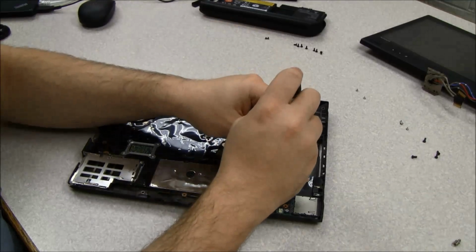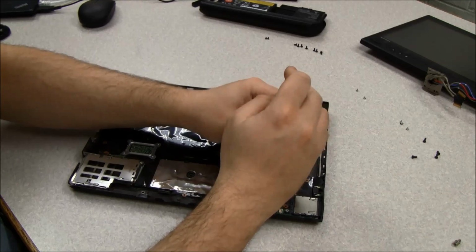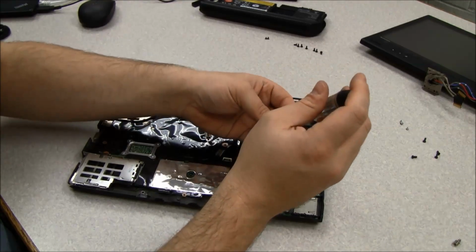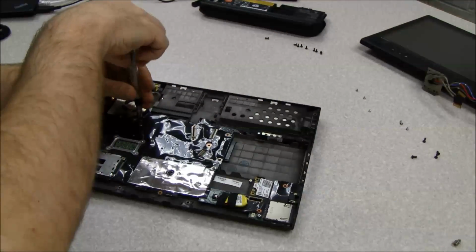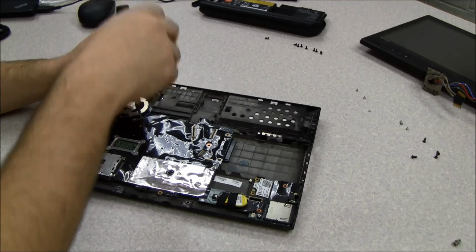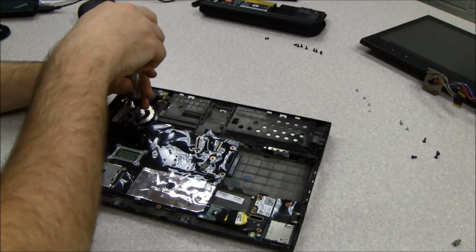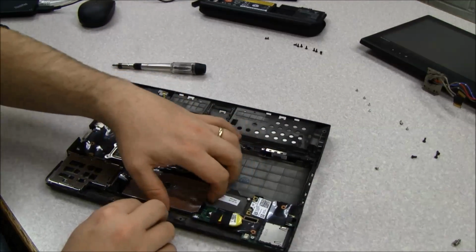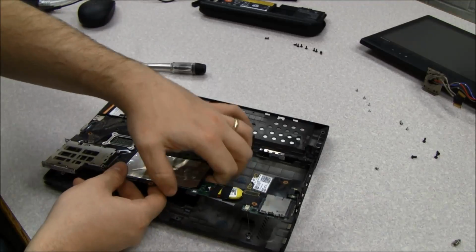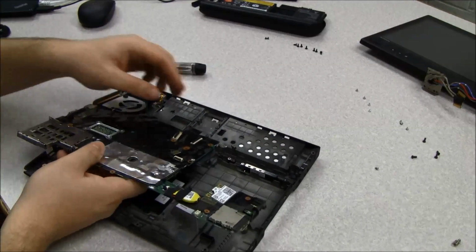So you need to remove the screw from the Wi-Fi card because while it's one, holding the Wi-Fi card in place, two, it's holding the system board down. There's one other additional screw over here in the center of the system board also. There we are. So once we get all the screws out, the whole assembly lifts out.